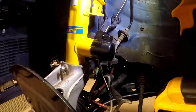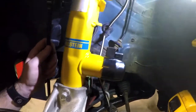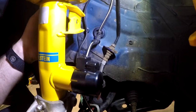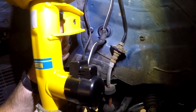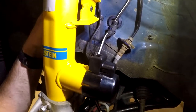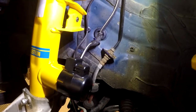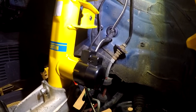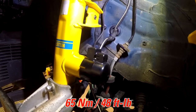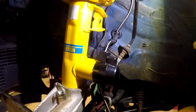At this point, I'm going to install my new sway bar link — I just went and picked up a new one from the parts store. The fasteners on this are a slightly different size and a different torque spec than before. The torque spec for this is 65 Newton meters. I'm going to work this in and get the nuts to torque spec.